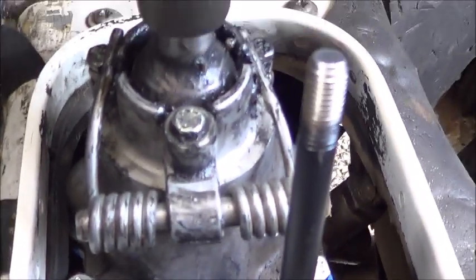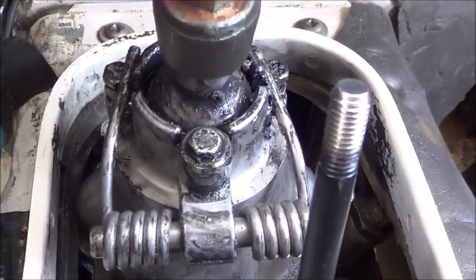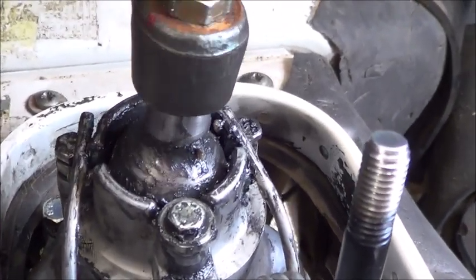So that's third, neutral. If it's too tight it won't get into fourth — you'll need to push it in quite hard. But the whole point of the slick shift is that it gives you a shorter throw for your gear lever, so you'll get a more positive action to get it into gear.